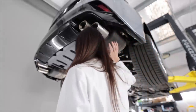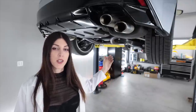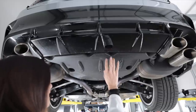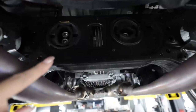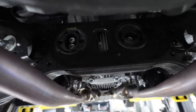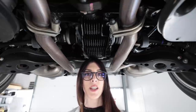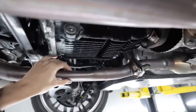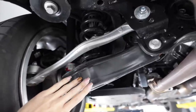They painted the mufflers — looks like they literally just spray-painted them black. Before we get underneath, I have to say Lexus was kind enough to loan me one of their prototype models, so this is pre-production and the fit and finish may not be 100% what it'll be on the actual production version. This plastic tray has little turbulence generators molded into it. On the IS 500 you get the Torsen LSD as standard, which normally comes on the Track and Fuji Speedway editions of the RCF. They really did crimp the exhaust pretty flat to get underneath the subframe — this car would benefit greatly from an aftermarket exhaust.